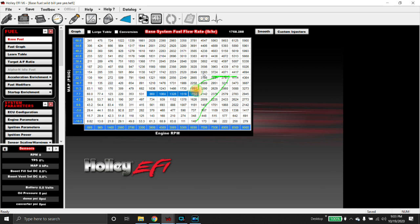This is really a very first time out with a car. These fuel numbers — if you're not used to a turbo alcohol or blower alcohol combo — probably look enormous. You're looking at 4,000 pounds per hour of fuel, which is ridiculous for somebody coming from a nitrous car, typically like 600 pounds per hour. What I did was basically calculate what I felt it was going to make for horsepower and use brake specific fuel consumption — how many pounds per hour per horsepower the fuel should support — and took a stab in the dark at each boost level.